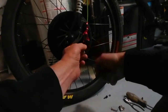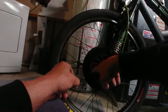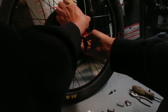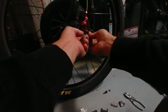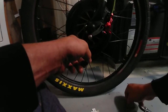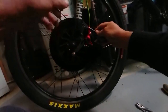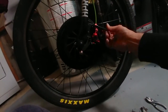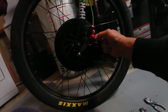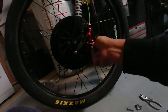What I do now is put these spacers in, because if I don't, the pad will actually rub on each finger and make massive clicking sounds — I figured out how to get rid of that. What I'd like to do is squeeze the brake and tighten the caliper at the same time, because what that does is close both cylinders at the same time and centers it while you're tightening the bolts. Then when you let go it saves it from trying to re-center. One thing I do want to pick up is a torque wrench — for now I'll just give it a little twist to tighten it up.